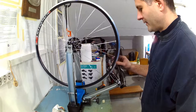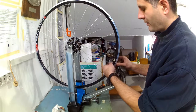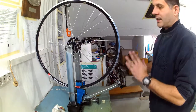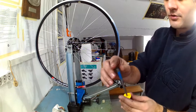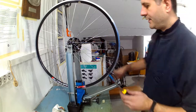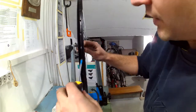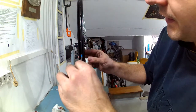In order to achieve this I have made a custom tool out of an old screwdriver. It has filed sides and left just one sharp and narrow section about three and a half millimeters long, so when screwed in it turns the nipple until it is pushed out by the spoke coming closer. This disengages the screwdriver and guarantees that all the nipples are threaded in by exactly the same amount as much as possible.